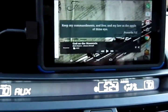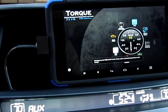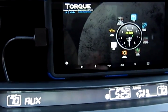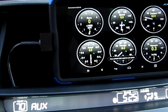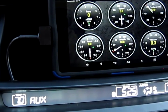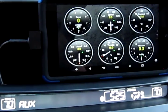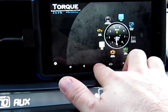I'll go over to Torque and launch it. You can see it's going to connect to the car. I haven't configured anything in Torque yet so there's no real data configured, but I can get real-time information from the car sensors — you can see it's connected. I need to change some of these gauges around. Torque is working and I can pull my check engine codes from here as well, which is possible with the Scan Tool MX that I have plugged in.